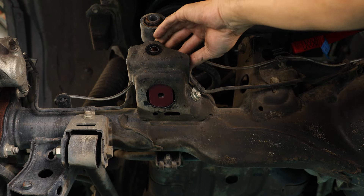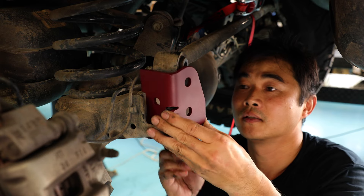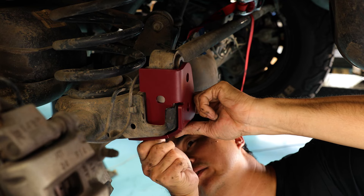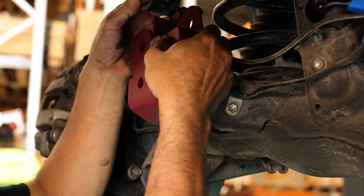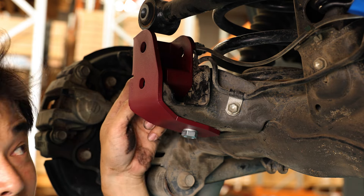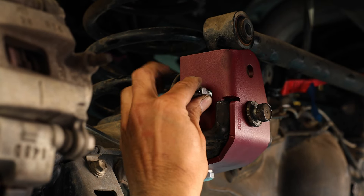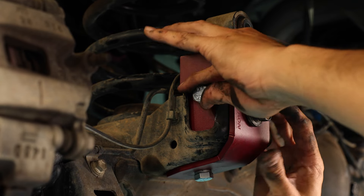One of the mounting points is a tap plate in the bottom — put the plate with the spigot facing down and it drops into that recess. Put the bolt in there just to make sure it's positioned properly, then remove it. Next, put the main block — this folded bracket — into the original position: slide it through and twist it. Get the bolt through into the bottom tap plate. We've got the inner mounting block which bolts in from the bottom and has the relocated pivot on the top, with a thread on the back as well. Come in from the top, drop it in, make sure the bolt and the M12 bolt on the back line up, and hand-tighten everything.